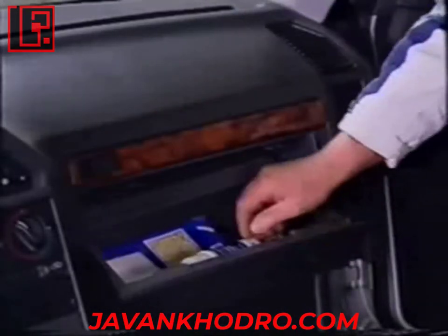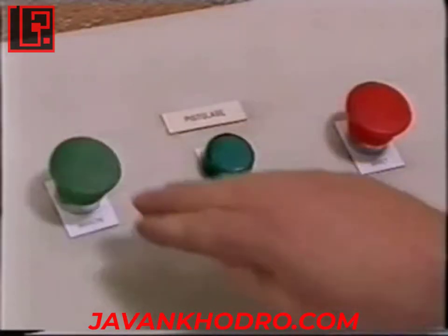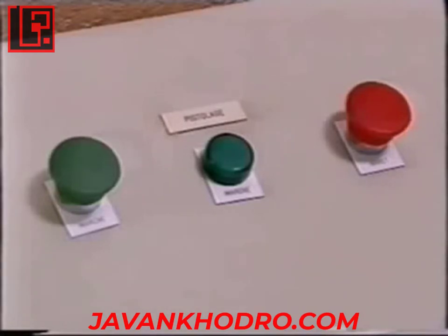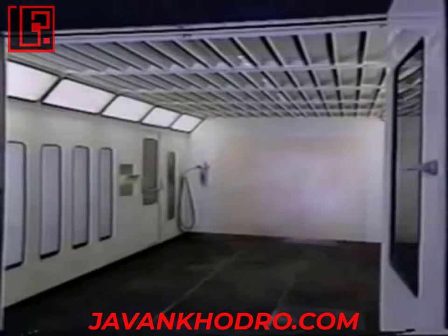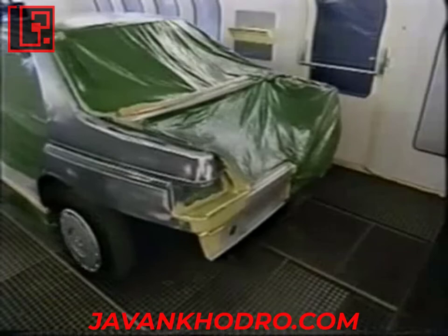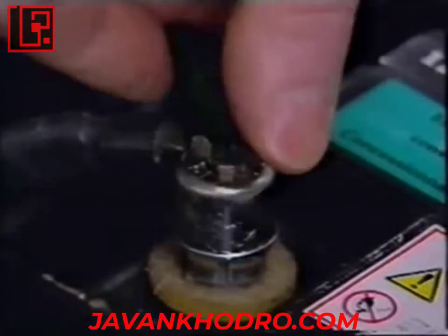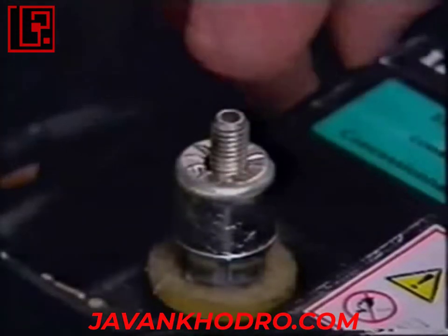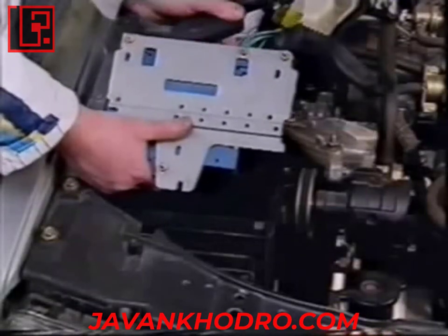Remove any aerosols from the vehicle. In the case of a diesel engine, start the booth ventilation. Indeed, the exhaust products can prevent the paint from adhering during the application. Lastly, check that there are only the objects necessary for work completion in the booth. Then reverse the vehicle into the booth. Disconnect the battery and remove the electronic boxes as they do not withstand fast temperature rises.